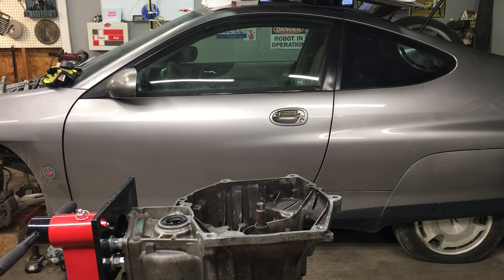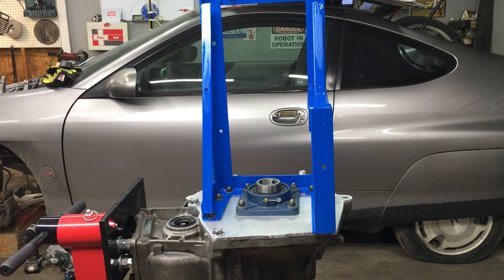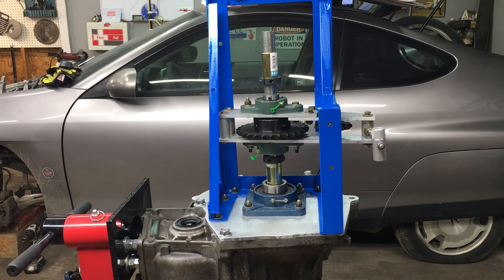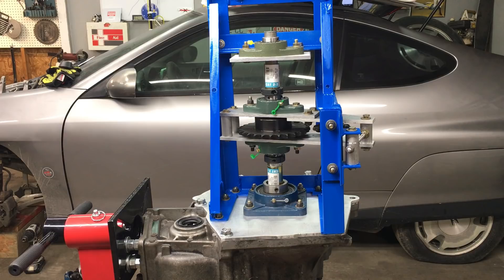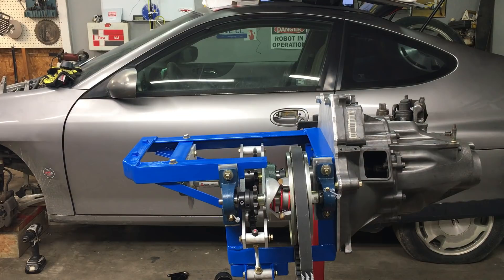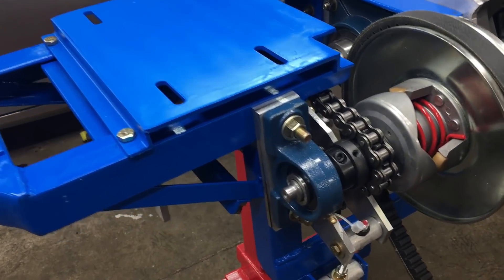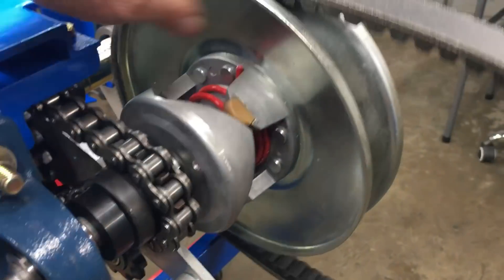It's time to put this thing together. We'll start off with the transmission input shaft adapter, then the aluminum bell housing adapter with the freshly painted engine cradle. Next is the main shaft with the sprocket and chain slack assembly, the chain slack adjuster hardware, and yet another bracket to connect the slack adjuster to the cradle. The support bearing slips right in, a few bolts, some shims, and the jack shaft — don't forget the dry belt. The chain's adjusted and the whole jack shaft is locked together with the shaft keys, and everything's lined up perfectly.